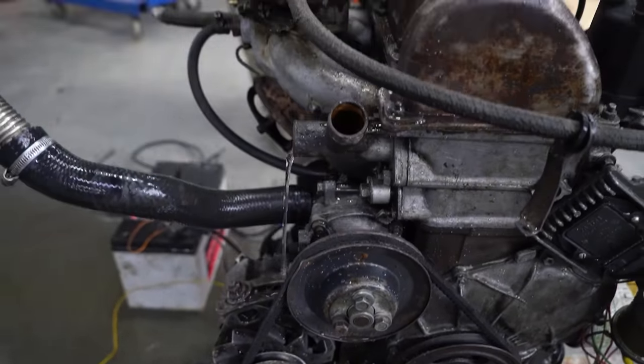This one right here. Oh, right, I see. It didn't quite seat itself for some reason. You can see how during installation it sort of got picked out of the groove and twisted. I thought I stuffed it in there. Yeah, good stuff. Did that happen anywhere else? What about this one? So yeah, apparently when we were fitting the pistons, these were caught on the edges of the cylinders, resulting in them twisting.